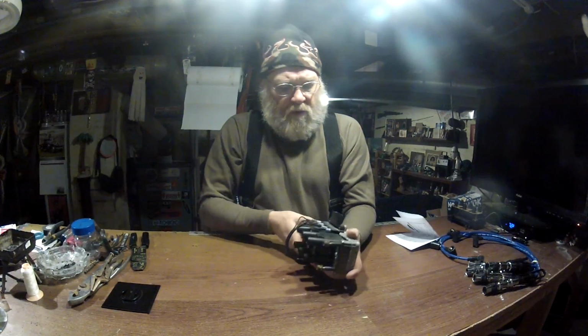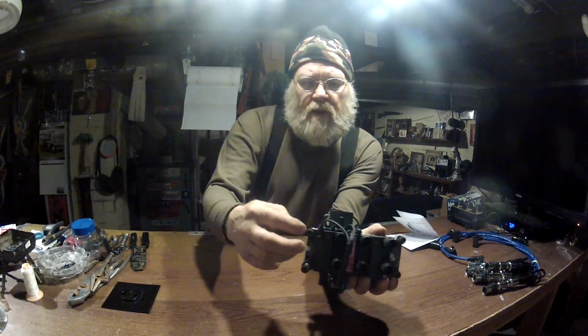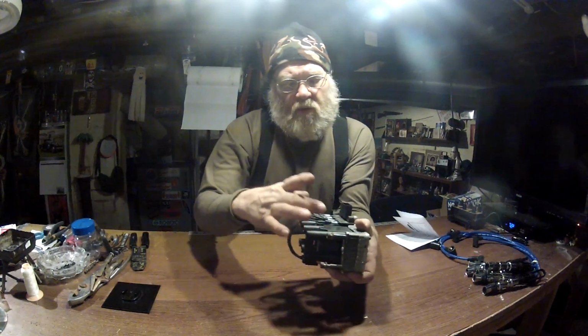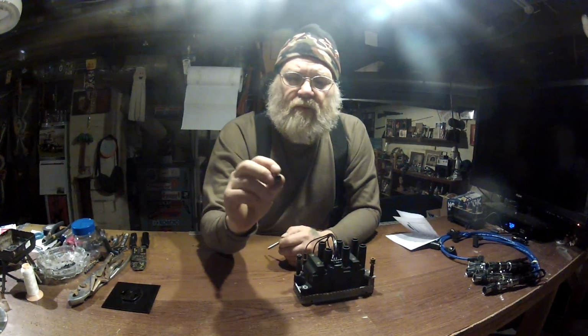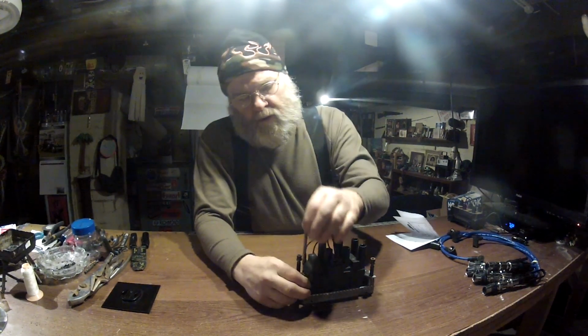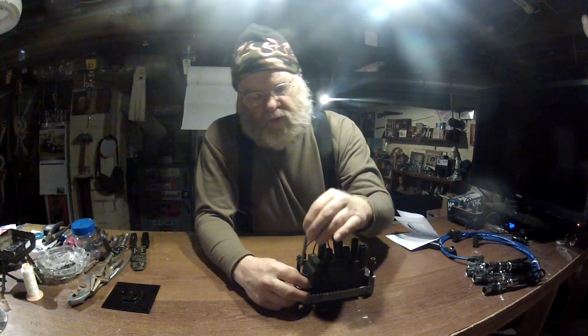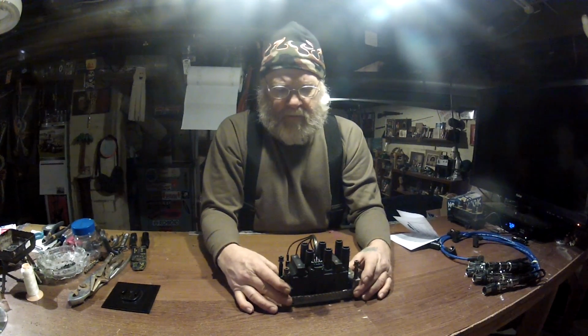This will go on first. You'll hook your connector, put your 4 bolts in. Your coolant tube goes on these, across these 2. Don't forget to put that back on. That's why I cut these spacers out of 5/16 brake line to make up the difference, so I could use the stock connectors and put my tubes and everything back where they're supposed to be.